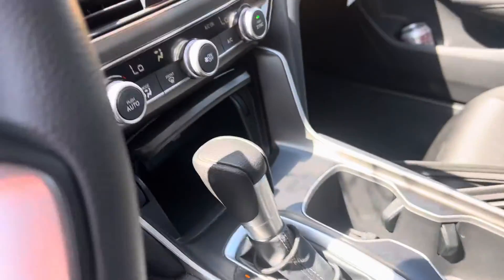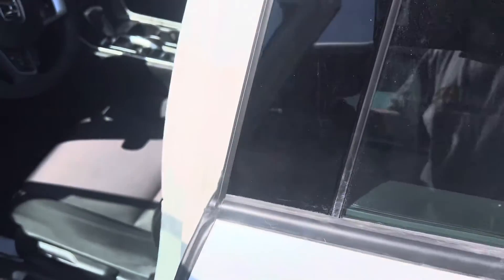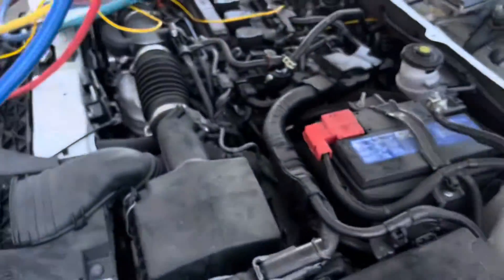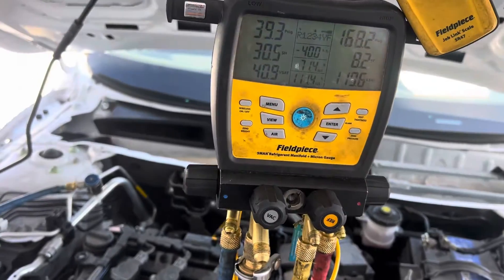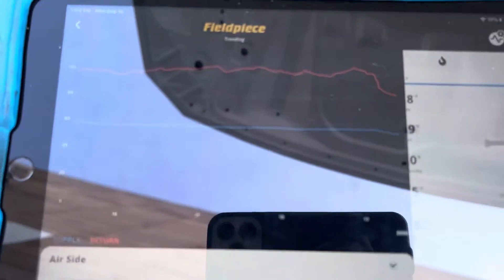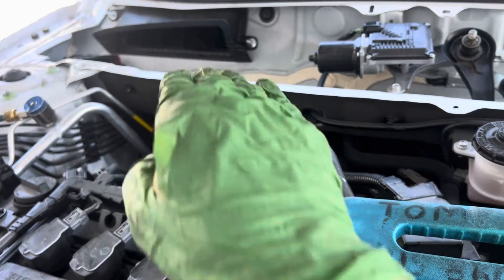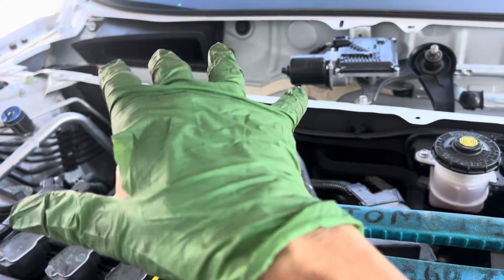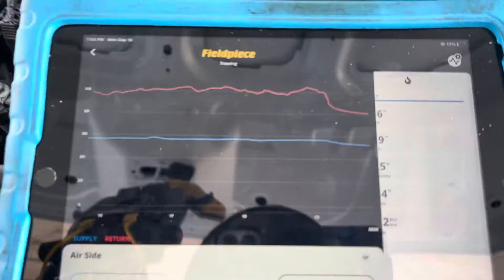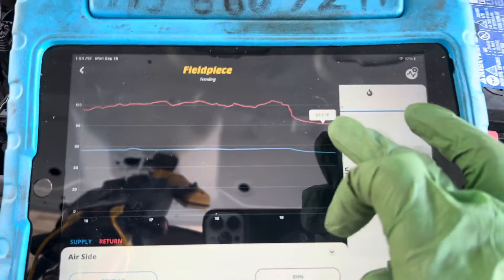Our ambient light sensor is still getting full direct sun and we're still in a black car out here in the sun, which is good. We're going to put this in recycle mode. There we go — we are now in recycle mode. Let's watch our decline and graph this because we know it's going to change. And there it goes. Right when I shut the recycle door, we are no longer taking in 101-degree air from outside. We are now recycling that 70-some-degree air.